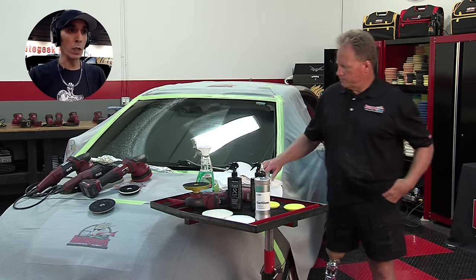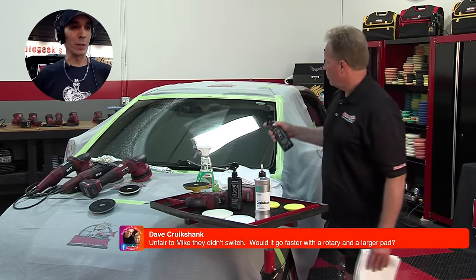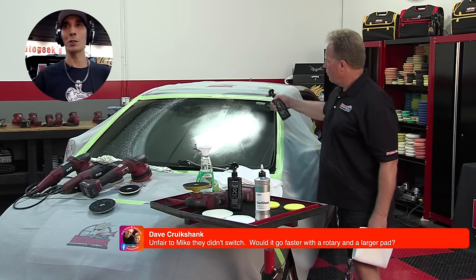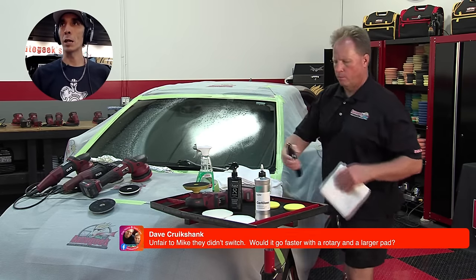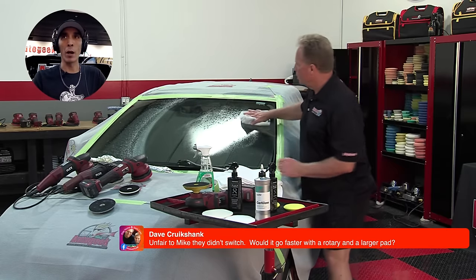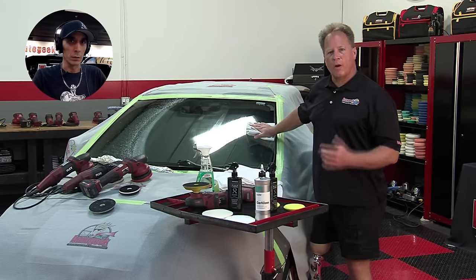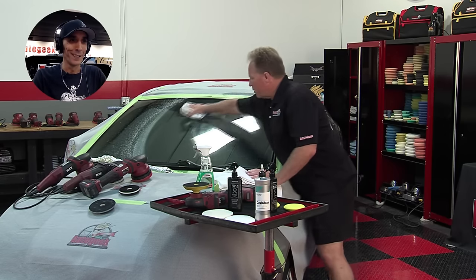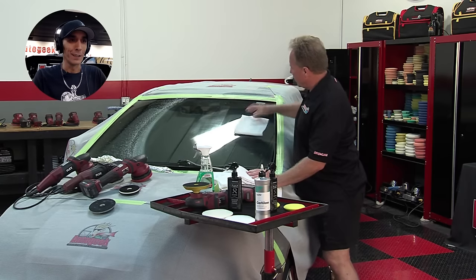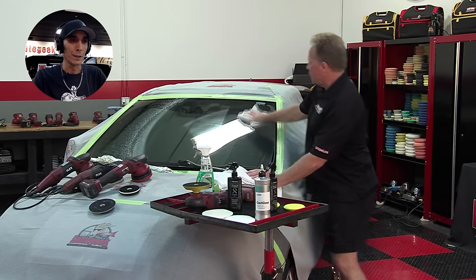All right, here, let's go to here. Remember, we're going to put a coating on here too. This one's funny. Unfair to Mike, they didn't switch. Way to go faster with a rotary and a larger pad. That's the largest pad that they make, is it not? Well, available to us are 5-inch glass pads. So we are using the largest pad that we could. To tell you the truth, if you had a bigger pad, it'd take a heck of a lot more muscle. Small pads are kind of nice on rotary, by the way. When I teach my rotary class at my detailing classes, I start the students out with 5-inch foam pads and then bump them up to 8-inch wool pads. But they start out small. You've got to walk before you can run.